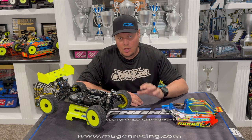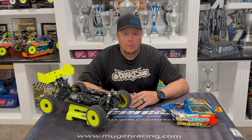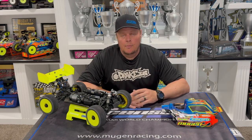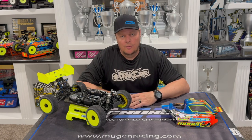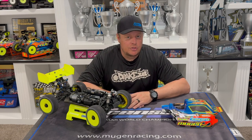Just to make it simple: boost is low end, turbo is high end. On truck I normally start with five degrees of boost and 10 degrees of turbo. At Motorama I went up to 15 degrees of turbo — there was a really big double in the back with a pretty good run up to it, and by putting that extra five degrees of turbo it just helped the truck pull through the face of the jump and made it a little bit easier to do, without making it too aggressive or difficult to drive through the infield.